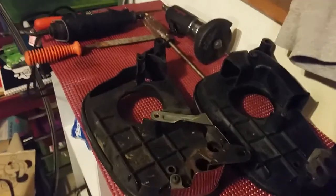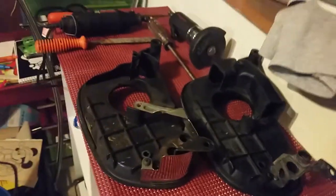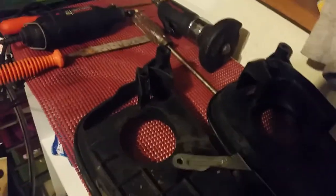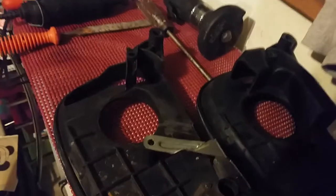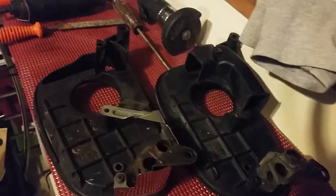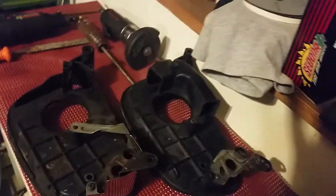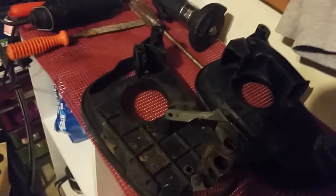When you put your bike away, you're going to want to pop that air filter assembly off, bring it in the house, and put a plug over your intake hole, because mice can now get in there a lot easier. I use mothballs — they seem to help and mice don't like them. Last year I just used a piece of duct tape to plug the hole and had no problems.